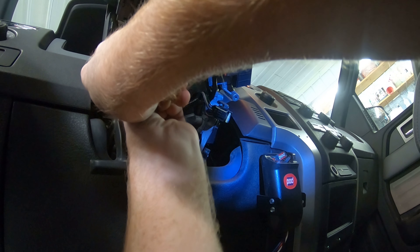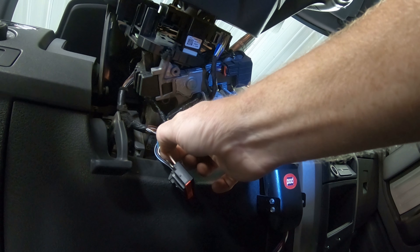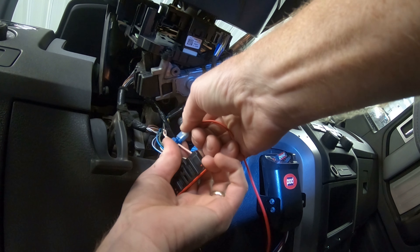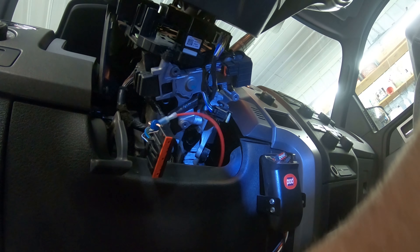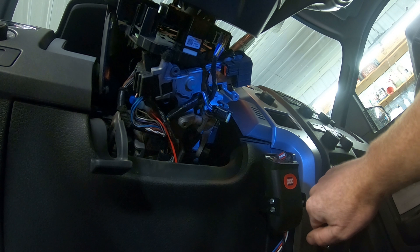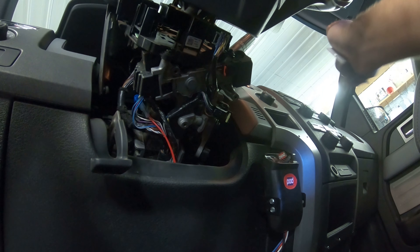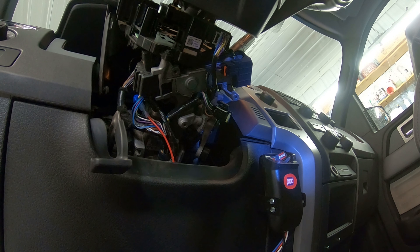We take the plug-in out and bring it down for better access. It is this wire right here — white with orange. I know that because I looked it up. We put our crimp connector on there and then we're going to use a T-tap to connect it to the wire. We can plug our wire in — nice and tight. We fish this extended wire down underneath and plug it back in. We will test it one more time just to be sure we got a good connection — testing it through the actual connector I just crimped on there. And we've got power.